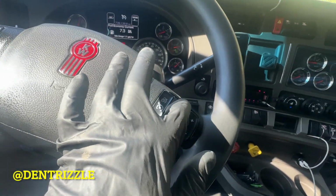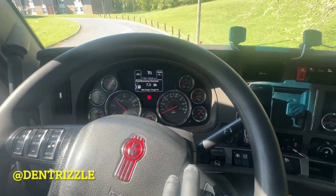After I got the truck started, I didn't turn off the truck. I don't normally idle the truck, but I have an OTR tool. In the morning before I drive out, I do a full regen so that I don't mess up the DPF system. Also, when the truck was idling throughout the night, I just upped the RPMs as high as it could go. Or you can turn on the cruise control, which is this guy right here, and then turn it up so the idle is up. That will prevent the engine cylinder head from not getting enough oil, so it gets more oil, to keep it safe somewhat.